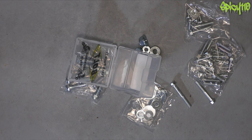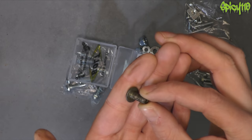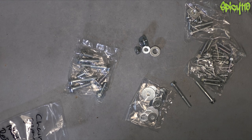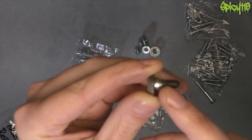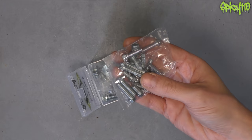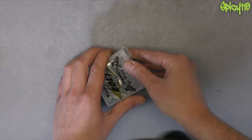Well, this doesn't have everything you need. I feared this was going to be the case, but we've got bolts that are handy to have. What I needed was a domed head, 8mm thread allen bolt. I thought it would include those - it doesn't. I've also noticed it doesn't have the ones for the subframe, which is fine. The other ones I need are another domed allen but shouldered - you can see this is one I had to cut - it doesn't have those either. Getting flanged bolts is not difficult at all, but getting the exact ones with the shoulder and correct dimensions is going to be harder.